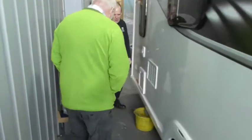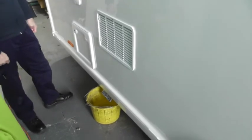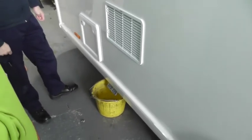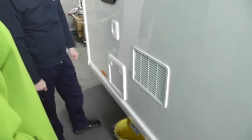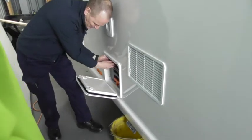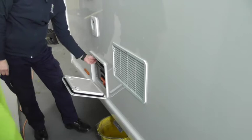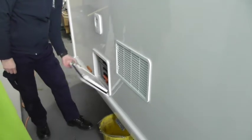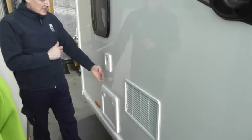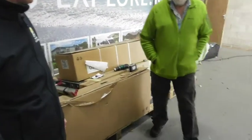The waste water outlet should be exactly the same. Toilet again — did you have the wheeled one? Yeah, that's exactly the same. You've also got the drain down for your flush tank. Make sure you are draining down for winter. You can flush it by using the flush button and flush it out of that tank, then drain the last little bit by that little pipe. The advantage of using the flush system is you're taking the water out of the pump as well — if you flush it and nothing's coming out, you've got a good chance of no water left in there.